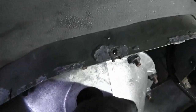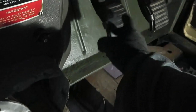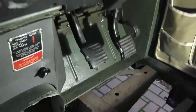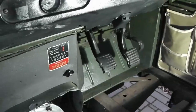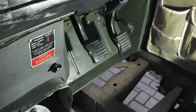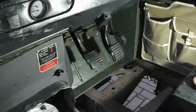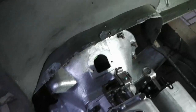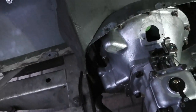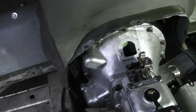That little bit of free play is important to allow the release bearing to come free from the pressure plate. If I just touch the pedal like that, it's touching - so that's how it should be. The manual does give a pedal height from the floor - I think it's something like 150mm which you set on the stop on the pedal box, but do check that figure. Anyway all seems to be alright so I'll disconnect the bleeder, make sure the nipples are nipped up properly, and that's that. I think next we'll get the transfer lever on, perhaps put the tips on the handbrake.